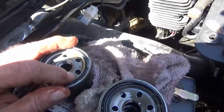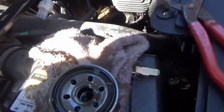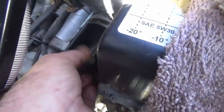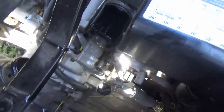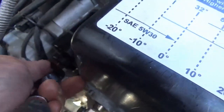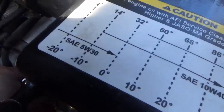Get that gasket slicked up so that you don't have to worry about it adhering to the aluminum housing when you tighten it up. Thankfully the cup that I have does fit this filter. One thing you want to make certain of as well is that the old gasket from the old filter doesn't stay stuck to the engine, because that thing will leak like a water fountain if you don't catch it and you start it. We're going to grab the cup and the ratchet — there's no need to tighten these things down crazy tight. Okay, that's as tight as I'm going with this.